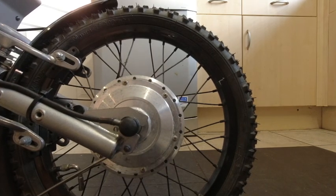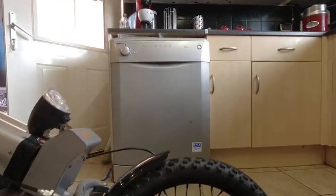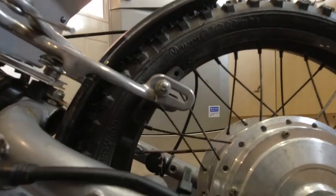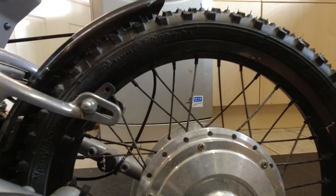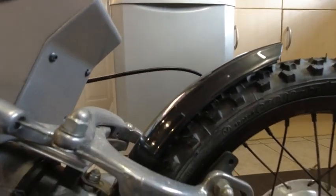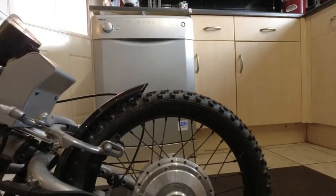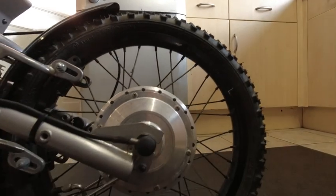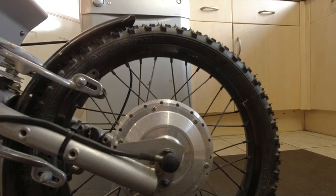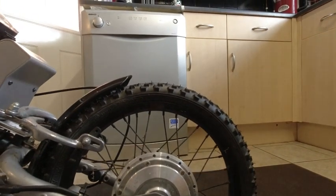Make sure you've got your brakes all on properly and set correctly. Press on your brake — I'll show you what I mean. I've got it on here. By applying them, just make sure they're making contact with your wheel. Make sure you test everything out. When you take your bike out for the first time, just go slowly and gently until you're sure everything's fine. Then come home and check the wheel again, make sure it's still nice and tight. I'm probably being overcautious, but safety comes first.